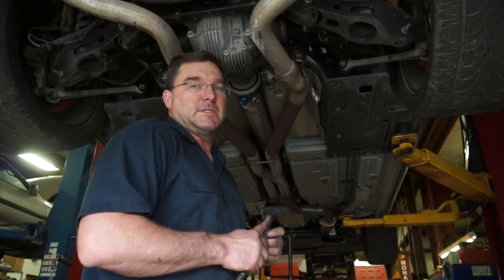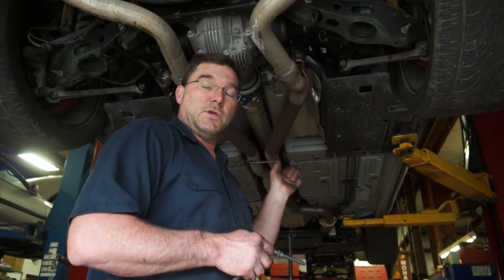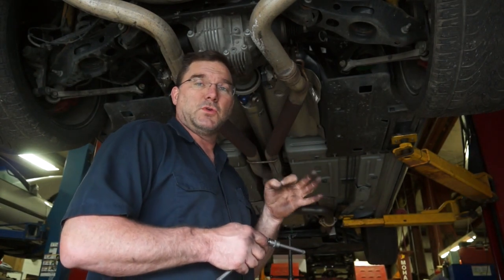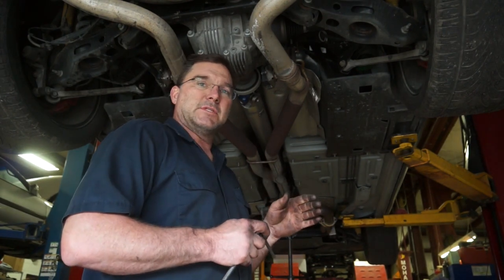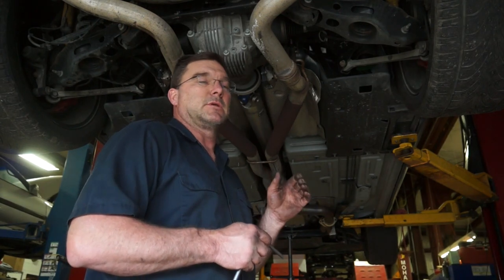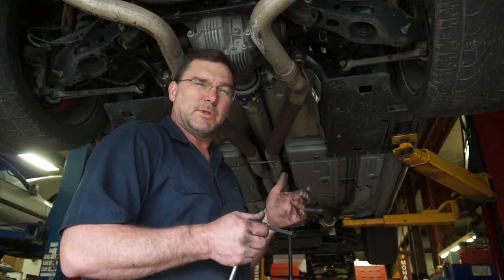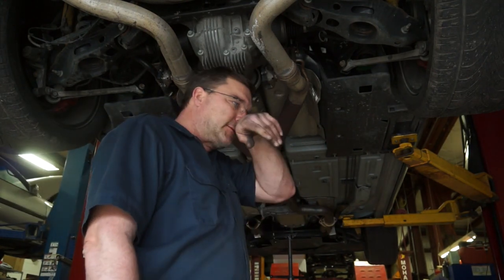So my front yoke is installed, Loctite, no half moon clips. The Sonex yokes have a recess for the shouldered bolt seats in. So you don't use the half moons, and the bolts you do have to cut down 20 millimeters, actually about 22 millimeters, to make them flush at the back, full thread contact, but giving proper grip strength.